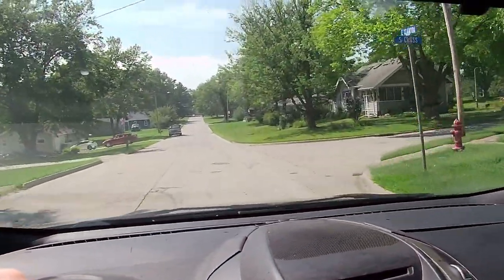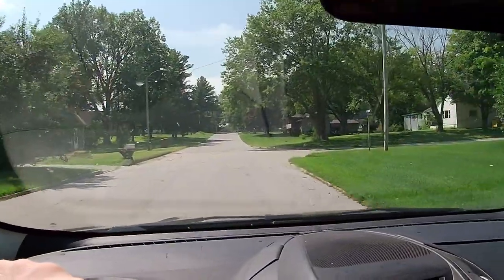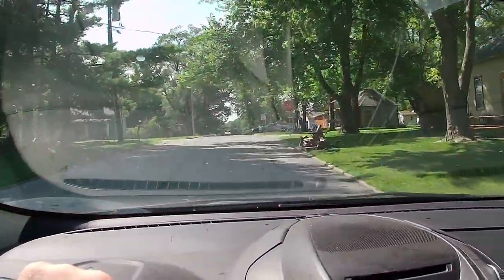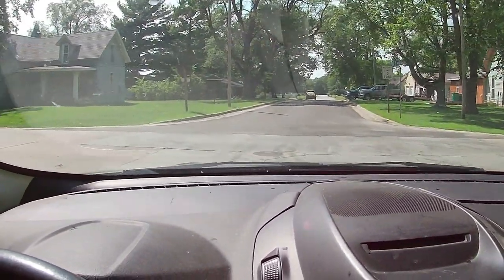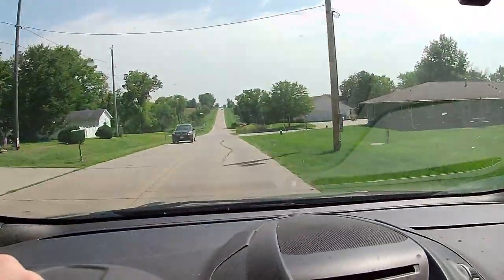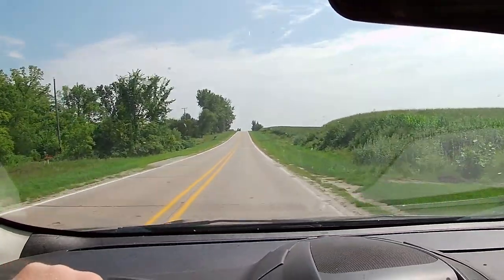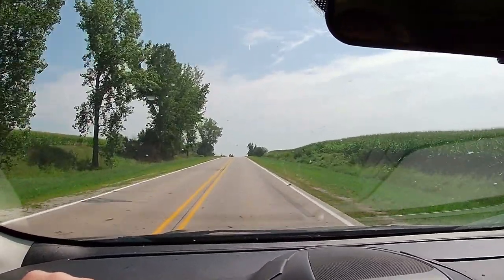She seems to be driving pretty good. To give a little backstory: I ended up retiming this three times due to misfires, and I was under the impression that I had mistimed it somehow. As a refresher, I had about nine months of dealing with Ford trying to get parts at a reasonable price. In those nine months, the octane of the fuel went down quite a bit — I'm almost certain my misfires were pretty much exclusively due to bad fuel.